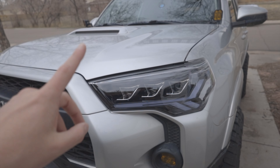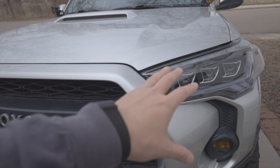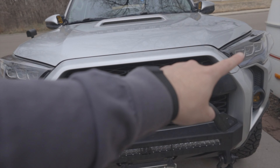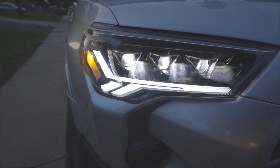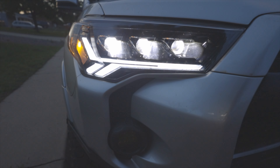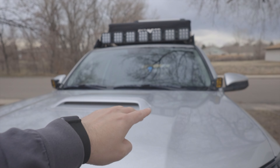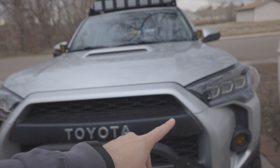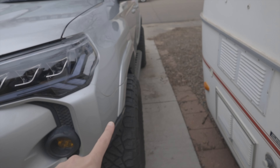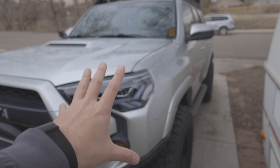When it first came out, one light was a little bit higher than the other, and all it took was a little adjusting to get them level with a nice cutoff. So I'm not putting my headlights right in people's eyes — I'm really seeing at about hood level. Especially with being a lifted vehicle, I already probably cause a lot of annoyance on the road, so I don't want to be blinding people as I drive by.